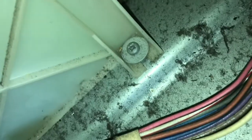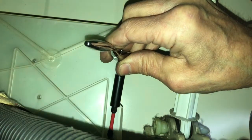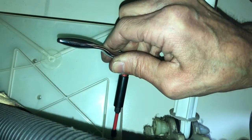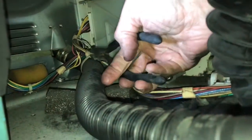With the breaker turned off, reach back and remove just two Phillips head screws that hold the motor control unit in position. It's located in the lower right-hand side near the back. I usually use a small ratchet with a Phillips head driver to loosen those two screws, then use my fingers to spin them off — doing the one closest to the front first, then the one in the back.